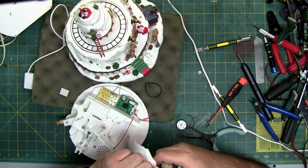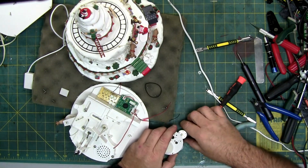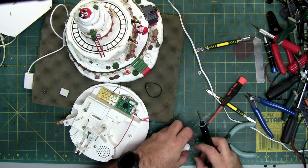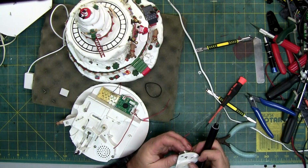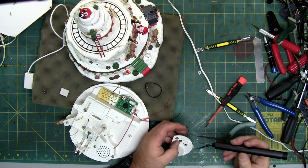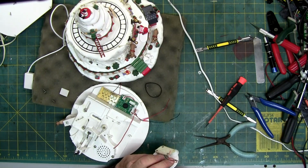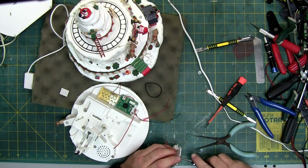So I'm wiping the grease off of the area where the motor attaches, so that way the new motor doesn't get full of grease as well. That is the biggest issue with these, is they over grease them. They get warm, usually in the summer months, even if you don't get to 120 in the shade like we do here in Arizona. And then the grease liquefies and runs inside because, you know, gravity. But even if you store them in your house, you still risk that chance, just because of how these things are manufactured.